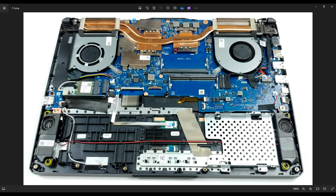The next thing I'll shout out are the speakers. You see this one here toward the left of my screen and this one here toward the right. They're not screwed down — they have rubber washers for soundproofing and you can just wiggle them right off those posts. This speaker is not plugged into the motherboard on this side; its wires connect all the way to the other speaker, which plugs into the motherboard right here. Just like the battery, you'd press on either side of that plug with your fingernails or a pry tool — manipulate the plug rather than pull on the wires.